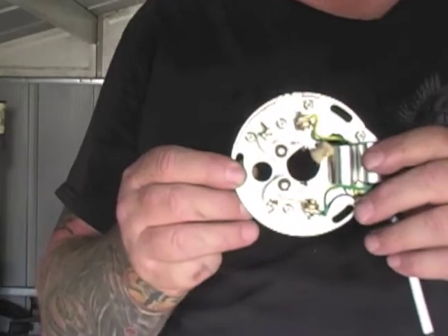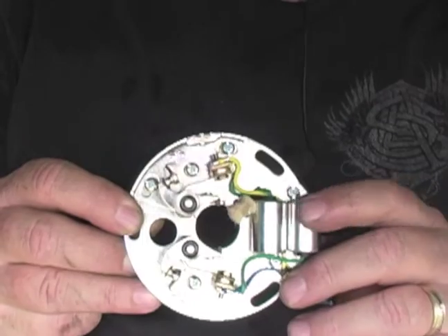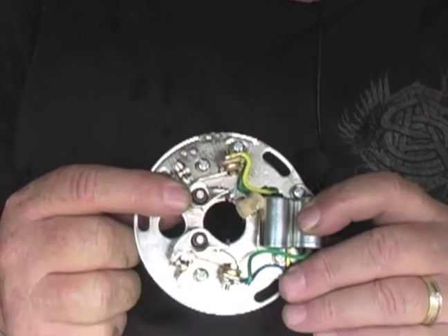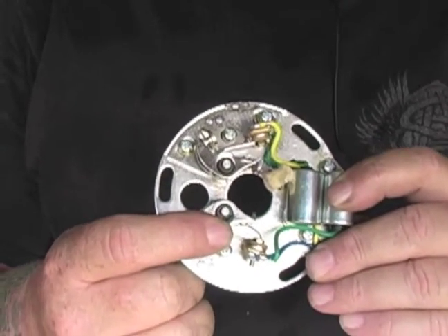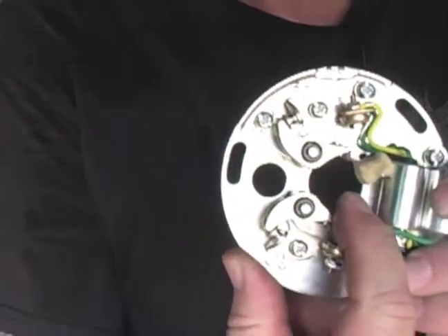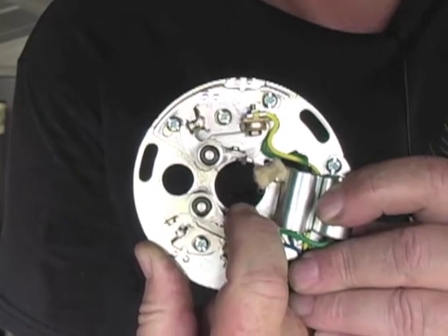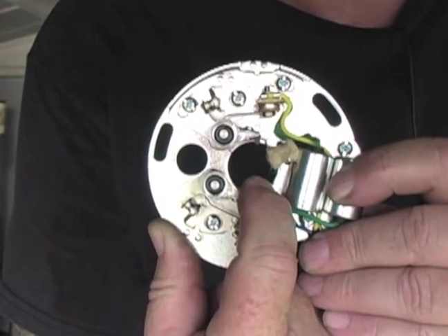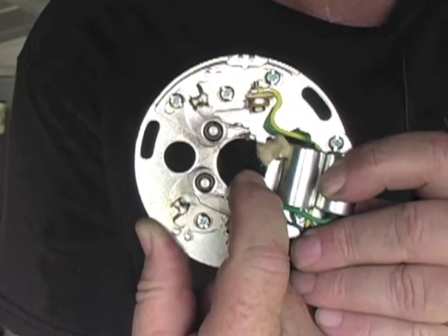Here's what they look like for the Honda. My finger here is on the condensers — we'll talk about that in a moment. And these are the ignition contact points here and here. They're really just mechanical switches, right on the cam lobe. You can see that they open as the cam lobe turns.